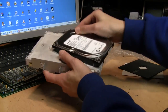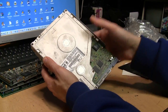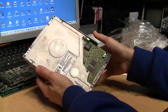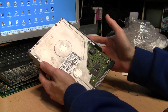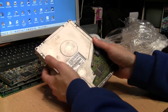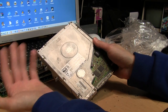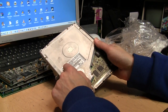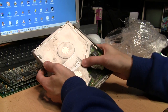For size comparison, here's a 3.5 inch hard drive next to the 5.25 inch Bigfoot. The reasoning for making these was that hard drive sizes were rapidly increasing in the late 90s. The two ways to increase capacity are either to increase the magnetic recording density on the drive platters — which is what most companies did, but that's expensive to develop — or the easier way: just make the drive platters bigger. So they brought out these 5.25 inch Bigfoot hard drives.